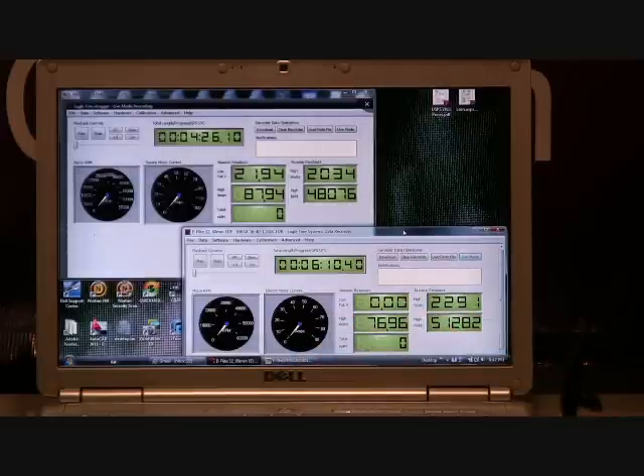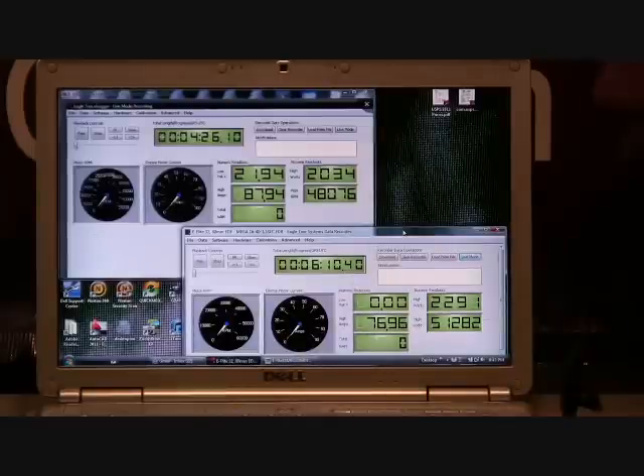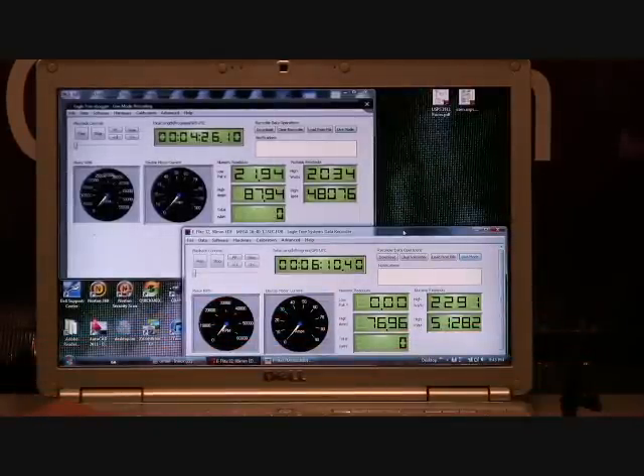The watts — we were just a bit over 2,000 watts at 2,034 on the 6-cell setup, and we're now pulling 2,291 watts. The bottom line is your RPMs that you're spinning the fan at and the F-Flux, and of course the thrust that we'll see here as soon as I zoom in on it. You'll see the settled out thrust as well. That wraps up our test today. I think it's a good setup — we're going to push it even more later on. This is a good solid motor; it ran nice and cool, 121 degrees with the heat sink. That wraps it up. Thanks for watching. Bye.